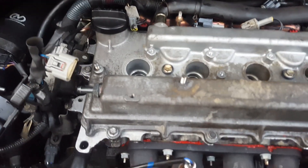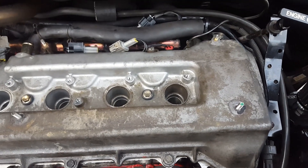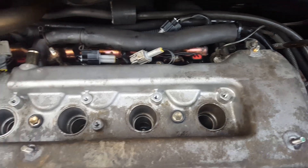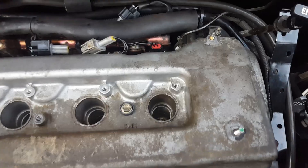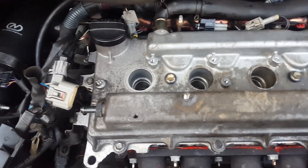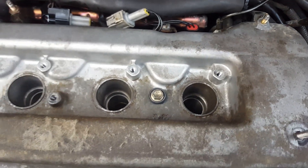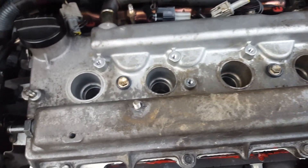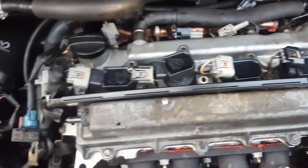I'm going to be honest with you — I haven't actually got a 3/8-inch torque wrench, so I've only got a half-inch drive one, and I'm not going to be torquing this down with a half-inch torque wrench. I've done it by hand and by feel. These rubber gaskets you can't really over-tighten anyway — it's the cork ones you have to be careful with. I think that's all nicely tightened down now.